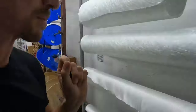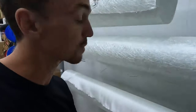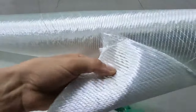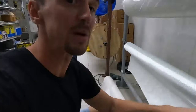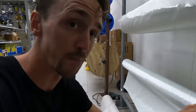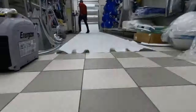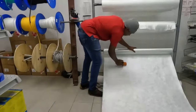You really need to be specific. Now a woven type of fiberglass is great and it'll look really good, but it's got no structure to it. If I'd done even just this on my last one, it would have been enough to keep it together so no water would have gotten in. But this one we're going overboard on. We're going with a fiberglass bi-axial — it has a woven top layer with extra stitching going across each layer, and on the bottom side you've got a chop strand that gives a little more thickness. That's going to give me two layers top and bottom, and four layers combined on the outside edges. I'm going to take nine yards of this.